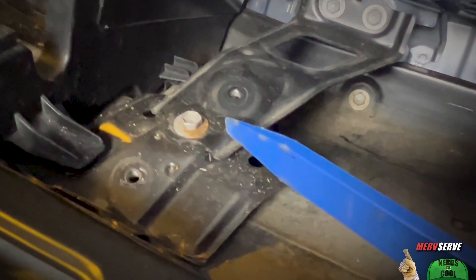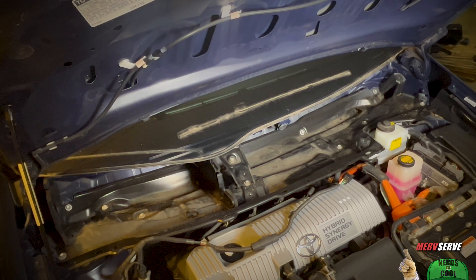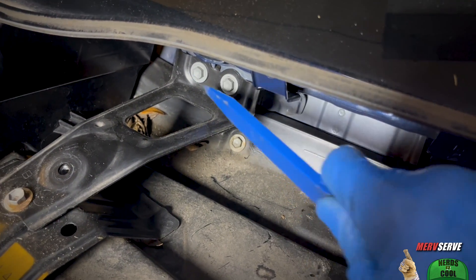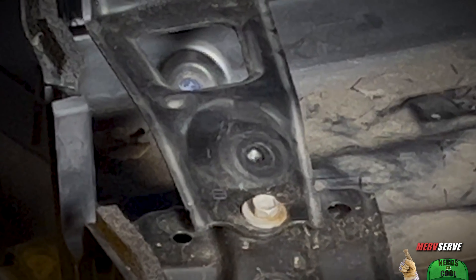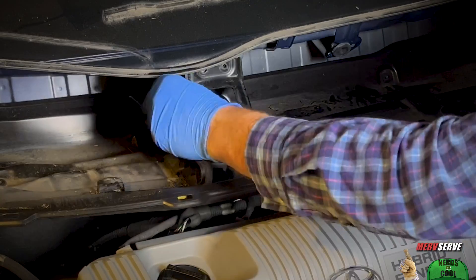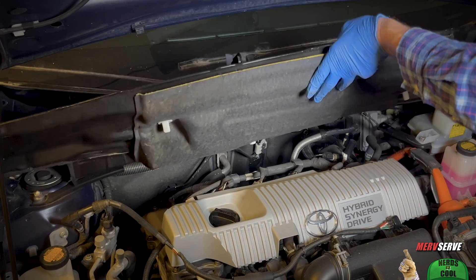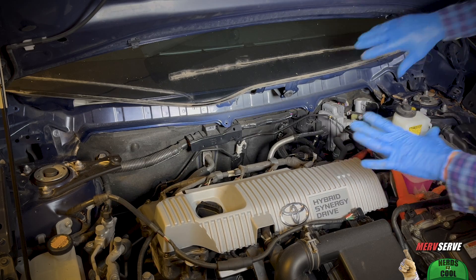Number nine is behind this bracket. Removing the bolts ain't worth making you watch, but there is a trick with this bracket that most people overlook. If the bracket ain't in the way of me taking out number nine, then all I'm going to do is take these two out, detach the bracket from the car, and then there ain't no reason for me to take out this front one. You will notice this opening in the bracket would allow you to reach straight back through to that bolt if you had like a 10-inch extender on your wrench. I just don't want to use mine because I'd have to walk three and a half feet to get it. Those two are out, this one stays in. Just got to fold this flap down, and carefully remove the cowl — tip it up a little bit, and she's out. Now that gives us lots of space to work on in this area back here.